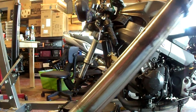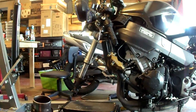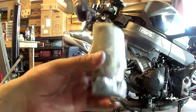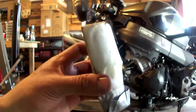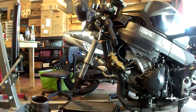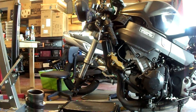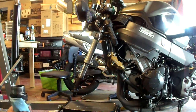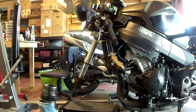The first thing we're going to do is clean this thing off a little bit — it's oily and dirty. A tool you're going to need to put this on is called a fork seal driver. Now they run for about $80 and it's just a useless piece of two half circles of metal that go together. I have this piece of pipe I cut and wrapped in some really soft tape around the edges so they aren't sharp — that's the last thing you want to do is cut open your fork seal. I used this to drive it in. I don't recommend spending $70 on a tool you're not really going to need too much. Maybe in the future I should buy one. So we're going to go ahead and clean this thing off and I'll show you guys a method of installing the fork seal.